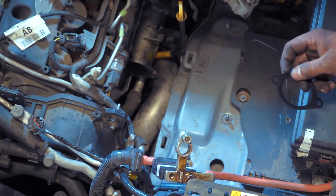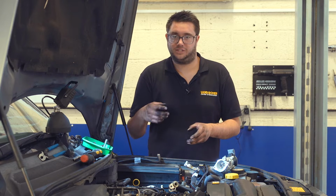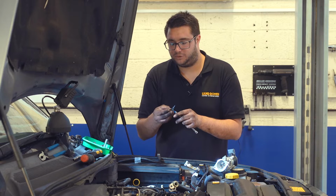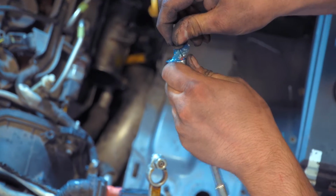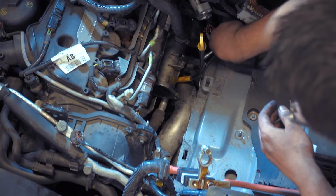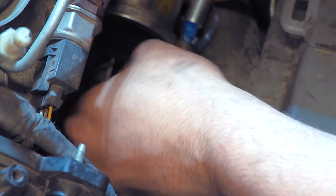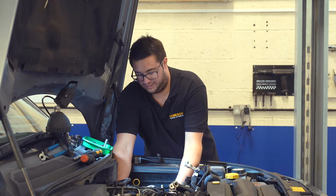First of all, we start with the outer screw, and then we'll do the inner one last because that's the hardest one to access. So first of all, get your Torx driver, and you can use a little bit of plastic wrapping over the end of the Torx bit and then the screw, and that helps hold it in place so that it doesn't drop off. So take that, feed it through the cooler, like so. Next, take the gasket, slide that over the bolt, and then finally we can lower the valve into place.